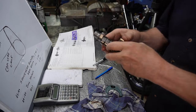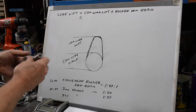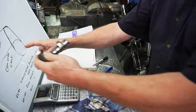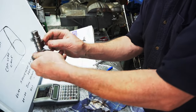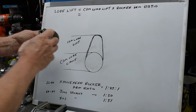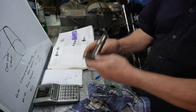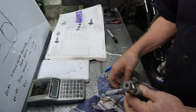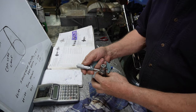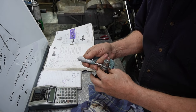By taking our cam lobes and trying to figure out what we have here, we have to understand how a cam works. This shows us our basic cam here with our lobe sticking up. This is our cam lobe circle — the complete circle around here without the lift — and then the cam lobe lift. In order to figure out our total valve lift we need to do some calculations. I measured this across the flat because we need to know the height of our baseline circle, just finding that sensitive spot where we're fairly close on the circle.